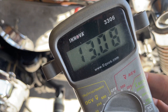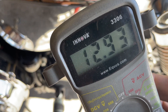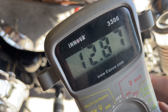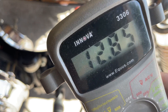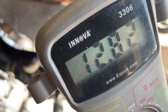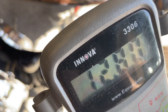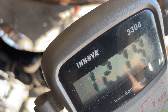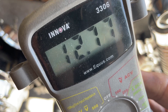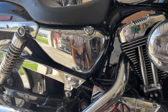Now you can see it's dropping — the bike has stopped. The battery's at 12.9. It was at 13, so that tells me the stator and the regulator are working just fine. The battery sits at 12.8. The bike has shut down, the petcock is on off, and now there is no fuel in this system to cause you any kind of problems next year.